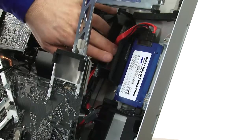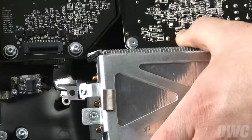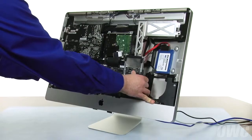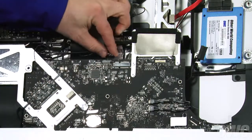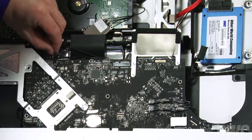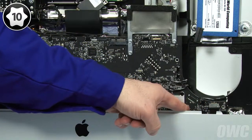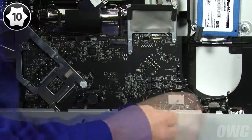Once they're all flat, you can set the thicker black cable along the others and ease the logic board back into place. When leaning the board back, there's a small piece on the iMac's frame that will catch against the left side heatsink. If you lift up slightly on the logic board, it should slide into place correctly. You can now plug in these three cables which you detached earlier. They're all different sizes so you can't accidentally mix them up. You can now replace the logic board screws. Start with the two lower screws which are the shortest. However, don't tighten them all the way as we'll need some movement to align the ports correctly.